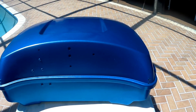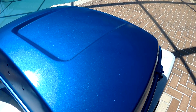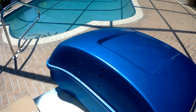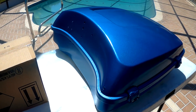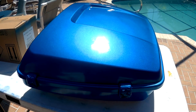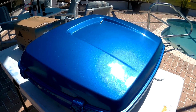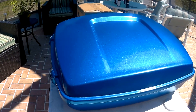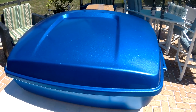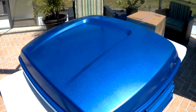And it looks pretty good. You can actually see the metallic that's in there. I think I might give it a couple more coats of clear, and then it's some more wet sanding, and then the final buffing. So you might not see some videos for a couple of days — just got to let it get good and dry before I wet sand it and buff it out. But it looks like I avoided a disaster.